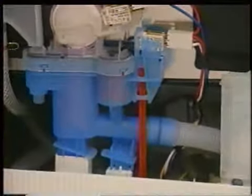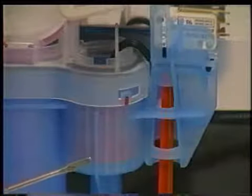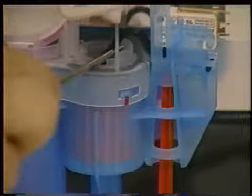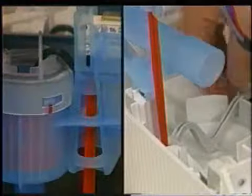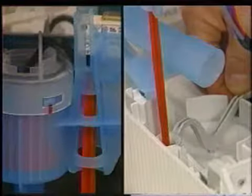The lower switch is the safety float micro switch, which protects against an overfill of incoming water or water leaking into the base. If the dishwasher were to fill with too much water, the safety float micro switch will close via a pressure diaphragm and activate the drain motor. If the base fills with water, a float in the base will rise up and close the micro switch via a push rod, again activating the drain motor.